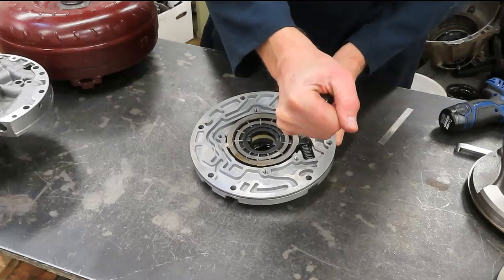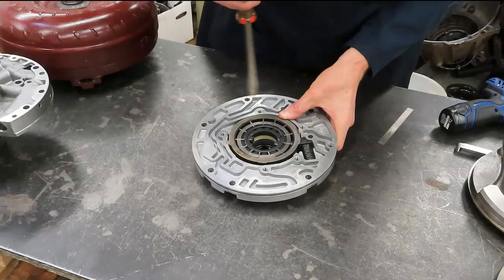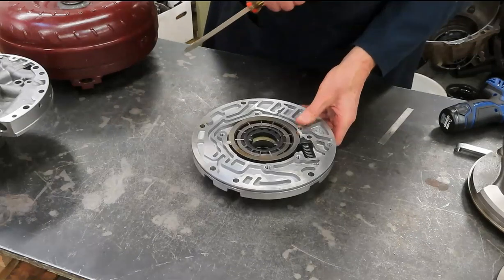And as you can tell, this side and this side become more equal as the slide ring gets moved. And that would be like cruise RPM or cruising speeds, light loads. This would be like acceleration on heavy loads, supplying the clutches with high pressure.